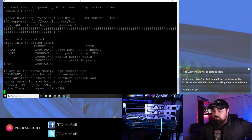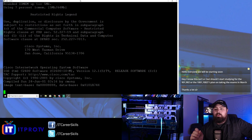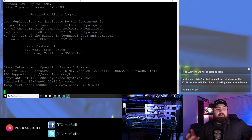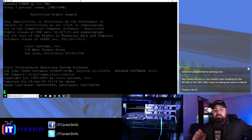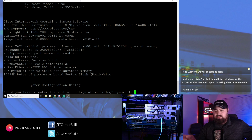If you guys are just joining, this is our first ever CCNA live study group. Right now we're walking through the steps on how you would reset a used Cisco router, really any Cisco router like these, to factory defaults. So we just issued the break command, and then in ROMMON we did a confreg 0x2142, and then issued a reset command, so the router reset.